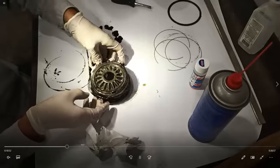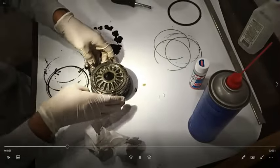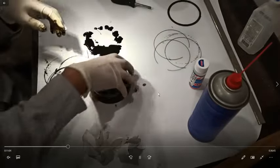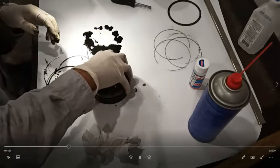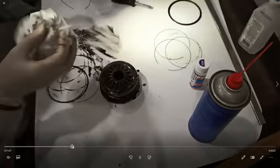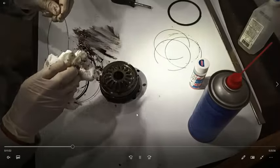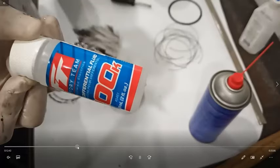Work the rings off gently. Be really careful with these wires — if you bend or ruin one, the whole thing is ruined. Don't bend them. If they do bend, it's better they bend outward instead of inward, because inward bends will cause problems. After removing them, clean each wire by just wiping them dry and putting them in a done pile. This is the fluid I used: 200,000 weight CST silicone fluid, two fluid ounces, 59 milliliters. I used the whole thing.